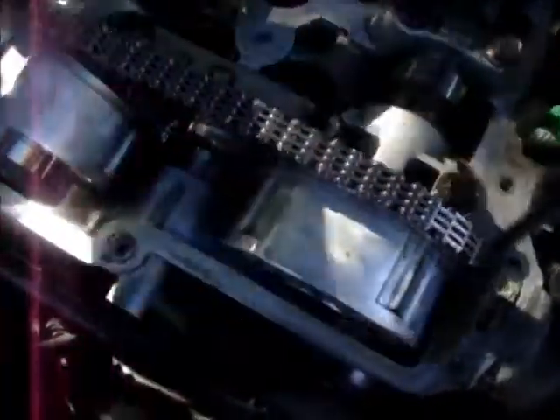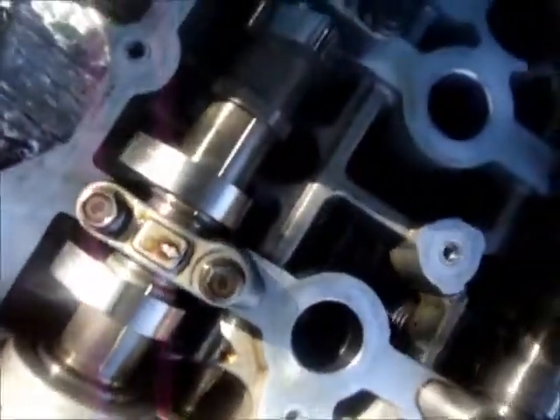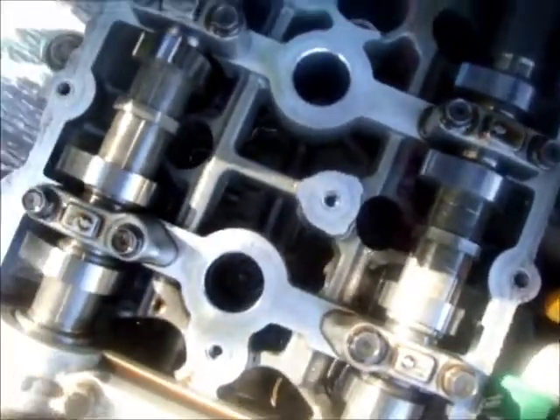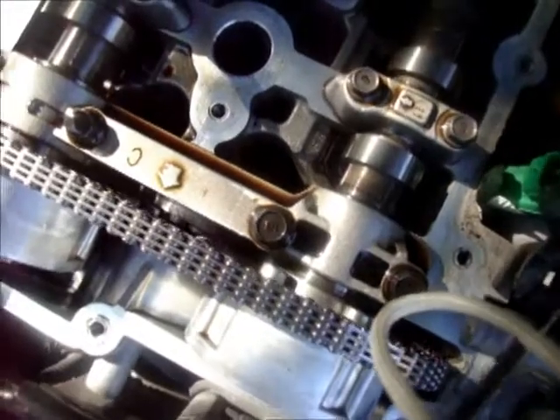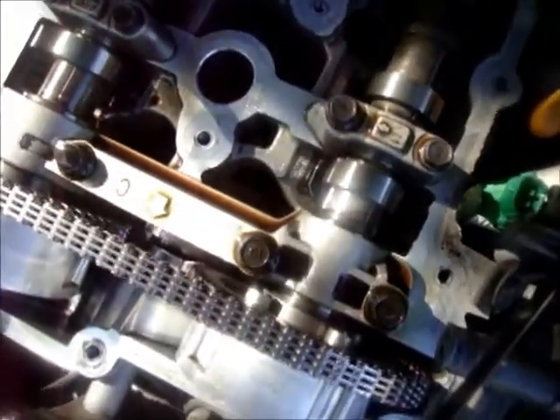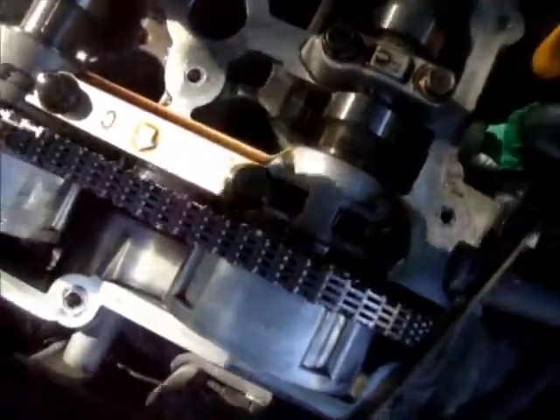The reason for that — and for those curious, this is where your crank vent would be. Maybe somebody's going to argue that the crank vent is in that particular spot for a particular reason. No, it's not. It's there because it was easy for Hyundai to put it there, basically. They probably had some volumetric equation to generate the ideal whatever. But the fact is it is a closed-deck system. It uses oil pipes to fuel the oil through here and to lubricate the bearings. The excess oil is dispersed outside of the bearing, and you'll see that it pools around the tappets.